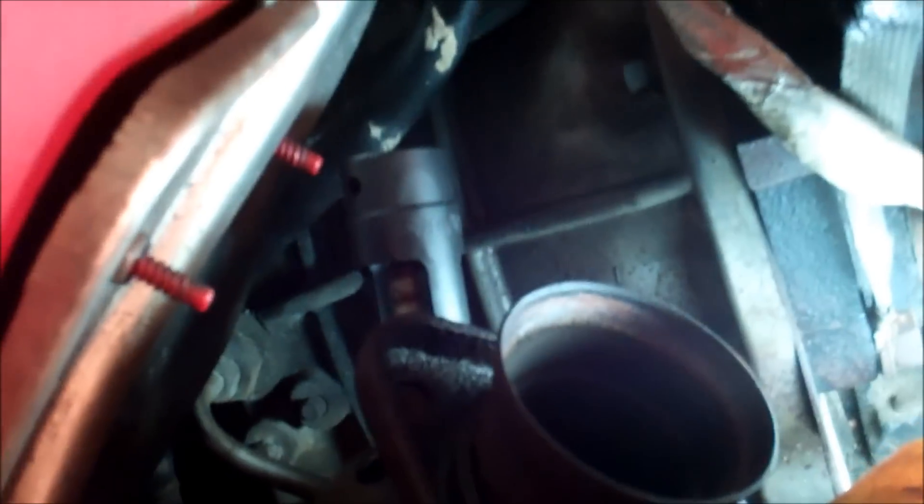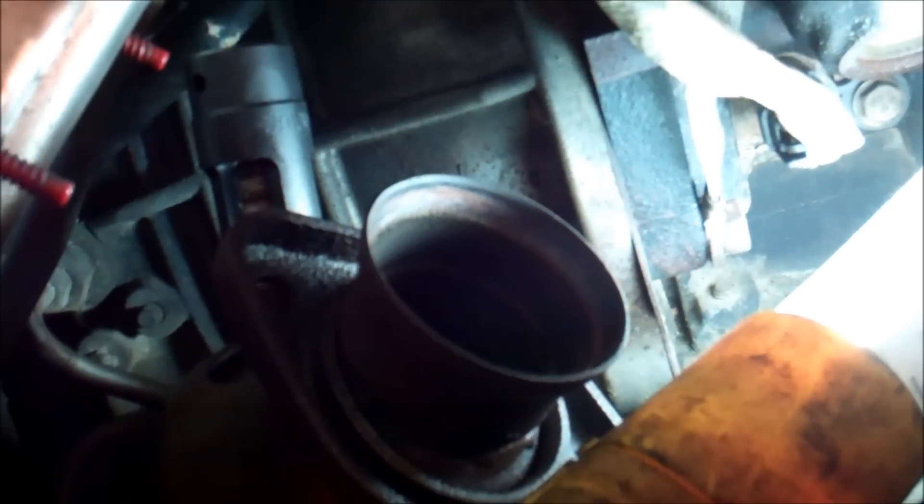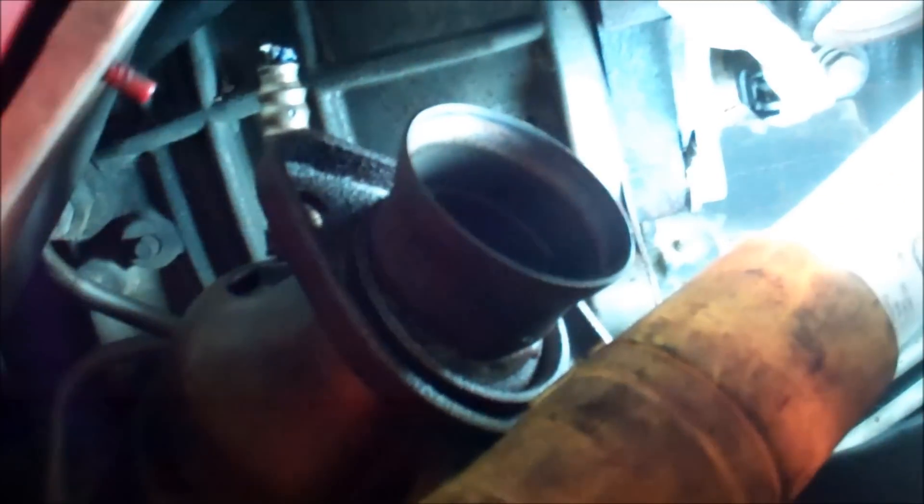To install the new oxygen sensor, the 22mm O2 sensor adapter I have just barely fits back there, as you can see. I lucked out because since I broke it free — after spraying it down with PB Blaster — I was able to break it free with my open-end box wrench. That gave me enough break that I can actually start to unscrew it and get enough leverage to get it on the way out.